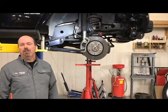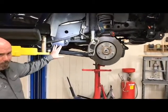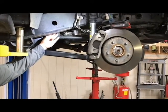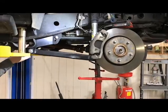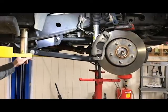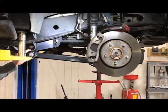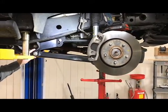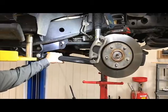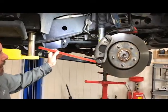What they did is they created this bracket, which attaches to the factory frame points — up inside where the original upper control arm was, and here where the original lower control arm attached. It drops this down about 2 inches as far as actual ground clearance of these brackets. You can see the three adjustment holes. This has a load on the suspension, so it's pretty close to factory ride height, and just to give you an idea, this is only a 2½ inch lift.